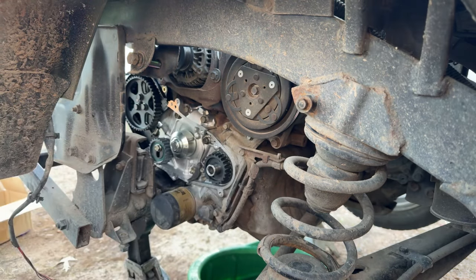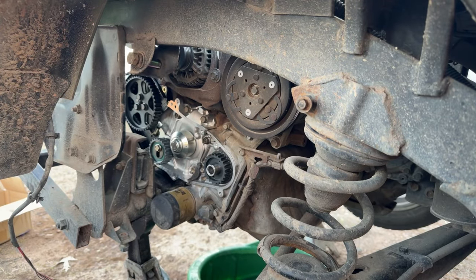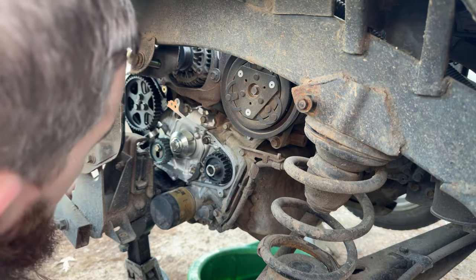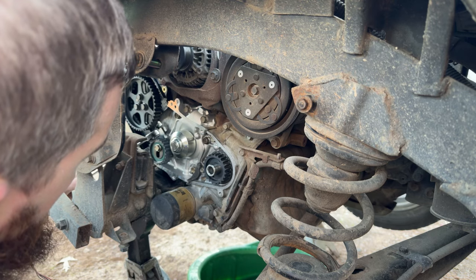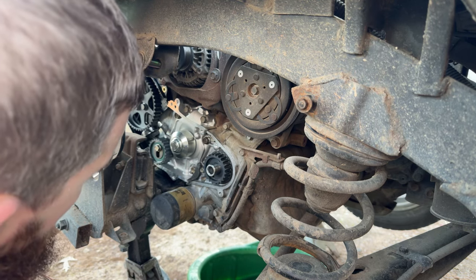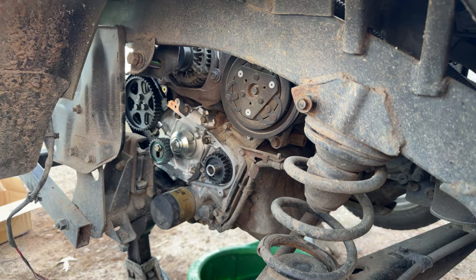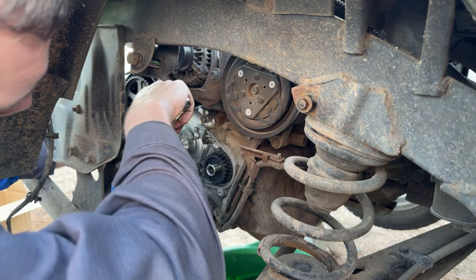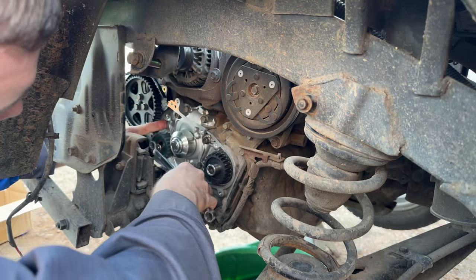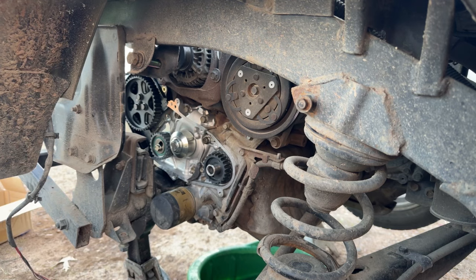Tighten. And take our open end wrench again, and we will push that tensioner arm up, stretch that spring out. Not that way. That way. Or, geez. It's not that tight. I can probably do it by hand. Let's see. Put all the strength of a finger on it. And tighten. And tighten. So our spring's loaded up.